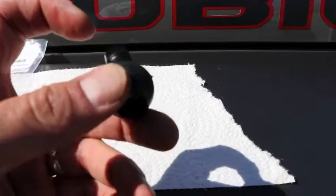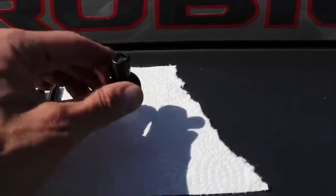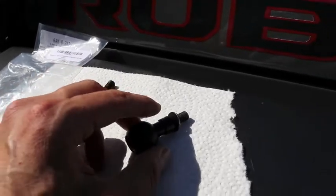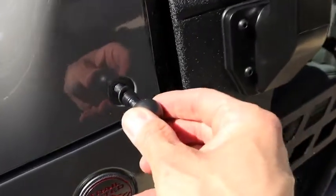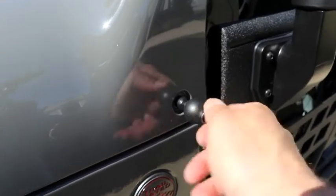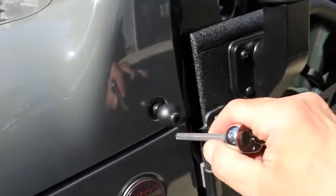It comes with this ball mount. This part right up here was silver — I've since spray painted that black to match the Jeep. This is all going to be mounted right in here. I've already loosened this. You take this cowl bolt out, set your RAM mount up with the ball, bolt through it, and I've spray painted a washer black as well. This then gets inserted into the screw hole. This bolt is an M10 1.5 thread pitch and it's about one and three quarter inches long. Then you just tighten it down to the Jeep.